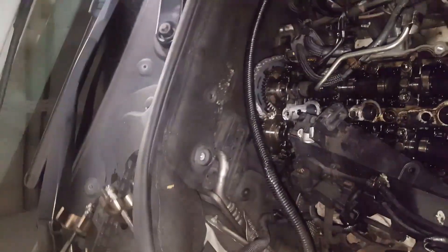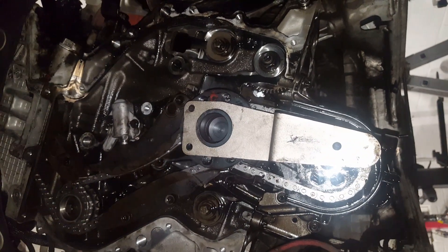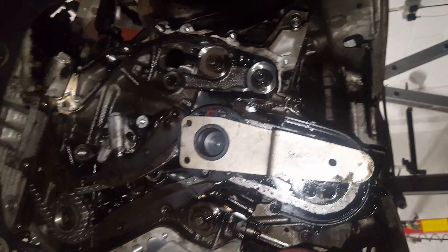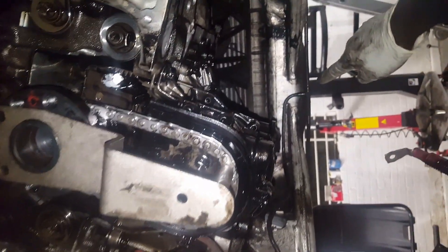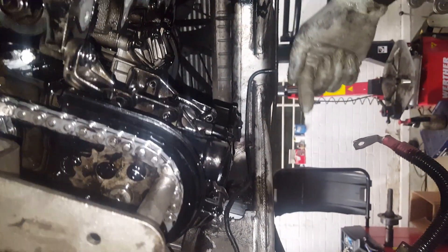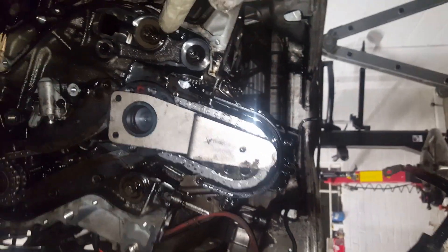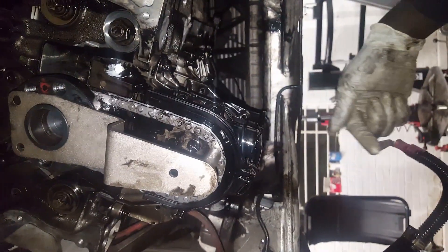The cam pulley is tight. I'm going to release the camshaft locking tool, jack up the car, rotate the engine twice, then recheck the timing. When you're at the back of the engine it rotates anti-clockwise. At the front of the engine it rotates clockwise - so from the back you rotate anti-clockwise; same direction of rotation, just viewed from the opposite end.